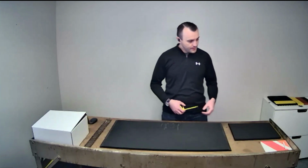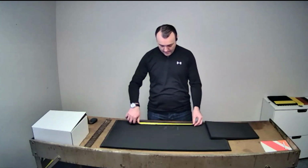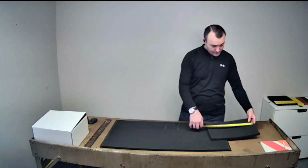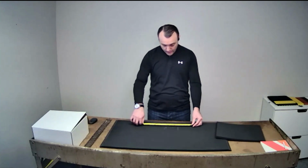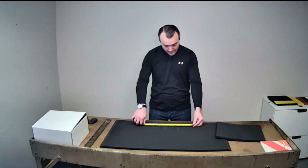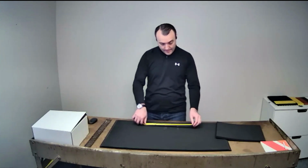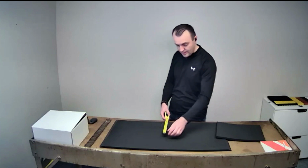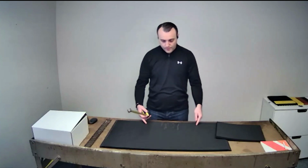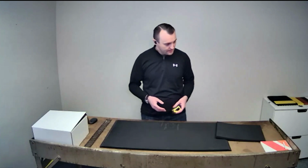We don't want any of that affecting the mat after we've made the repair. So to start with, we'll want to measure up for a new piece. In this case, you can see I already have the new piece here. We want to go a few inches on each side, so we're going to call that 15 inches. So a 15-inch width, and then the height, we're going to go up to 13 inches. That allows us plenty of room to cut out the damage, with nothing spilling in.